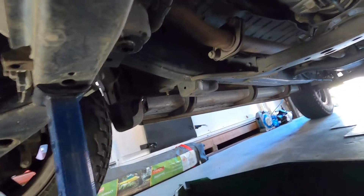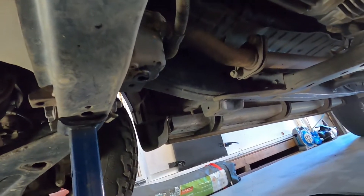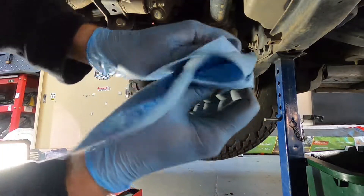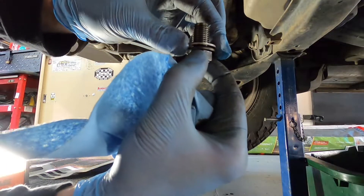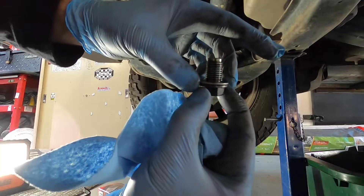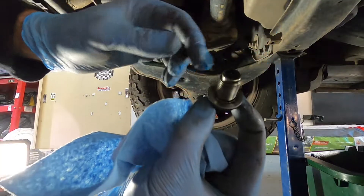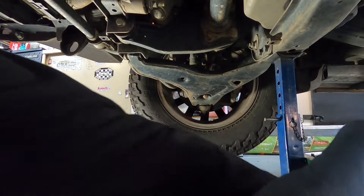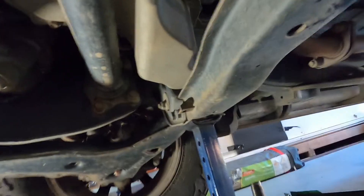That's pretty much it for checking suspension. We'll get under now, put the sump plug back in because that's had enough time to drain, and we'll also do the oil filter. The oil has basically just come to a drip. Get your sump plug and give it a nice clean. This is a good time to replace the little washer on your sump plug - you can get away with probably three or four services using the same one, as long as it's not squashed and splayed out. Throw it back in.